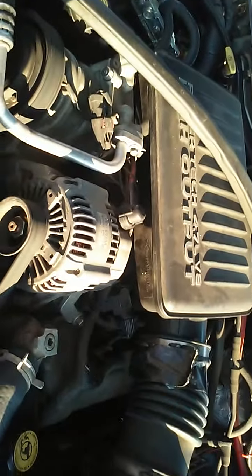I went ahead and sprayed starting fluid in here and was able to get it to fire, so it's definitely not spark plugs. It's not battery, it's not power, it's getting gas and everything that it needs, so it's not the fuel pump either. I didn't figure this out on my own, unfortunately — would have been a lot cheaper if I had.